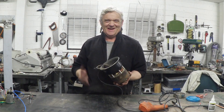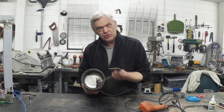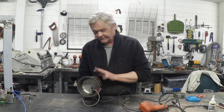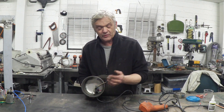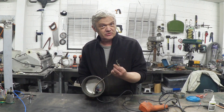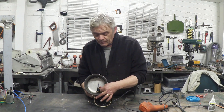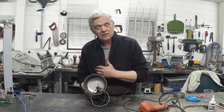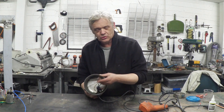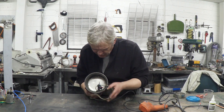That's everything fastened down to the pan and you can see the electronics here. When choosing the wires - there are four wires that go into this thing and there are lots of different ways of wiring this - but you essentially only look for the one with the greatest resistance. The resistance on this is 60 ohms. These two here are either the auxiliary coil or the speed control, because there's a low, medium, high speed in some of these as well. It really doesn't matter - you just choose the ones that have got the highest resistance and they're the ones that you actually attach up.